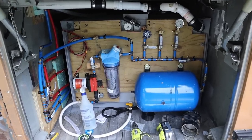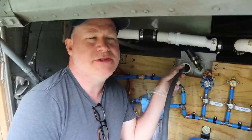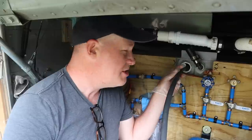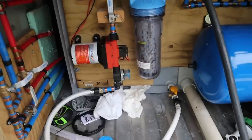I think we have all of the plumbing together and ready. This is exciting and a little nerve-wracking — did we get all the leaks out with the air? Will it work? First step: get some water into our fresh tank. There is a sanitizing routine we'll do for the tanks and water lines, but we're not going to do that until we can get to a fill-and-dump station because we need to cycle through a couple hundred gallons. We've got maybe 15 to 20 gallons right now. First thing we're doing is putting the fuse into our water pump's 12-volt wires.